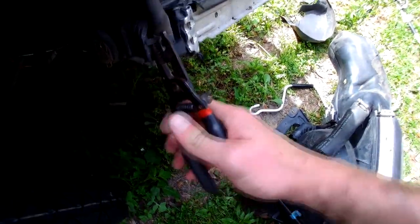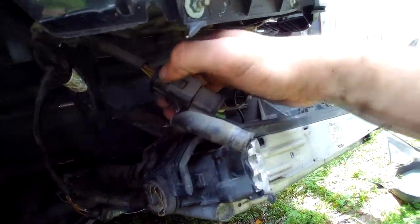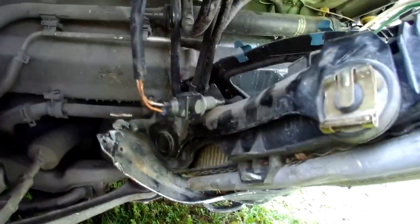The next part of the repair is to try to take the radiator stuff apart and figure out what belongs where. Disconnect this. I think it's a fan connector. From what I see so far, there is one bolt over there. It's actually all I see so far, so I'll try to take that nut off. First, to reach the other bolts, I'll start from the bottom. At least two bolts here.